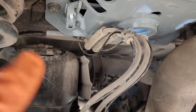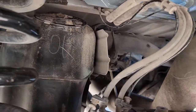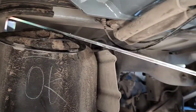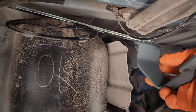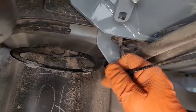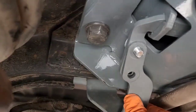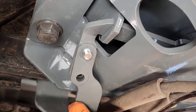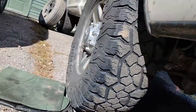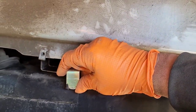There's a little trick to fishing the handle through. Best way I found is to come behind the brake lines up above the fuel tank and just feel your way through — fish it through the end of the frame and it'll seat onto your latch pin mechanism underneath. You can see it coming through the fender well just below the bed and above the frame rail. The tab is now turned downward as it should be and as shown on the operation sticker.